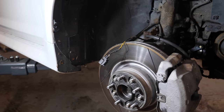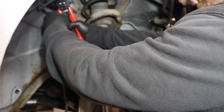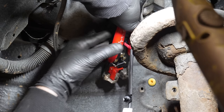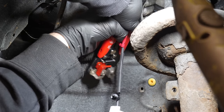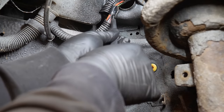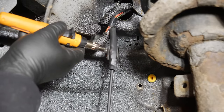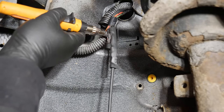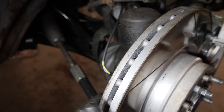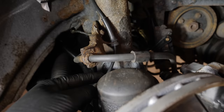This is definitely a first for me — I've never done electrics of any kind before. But this process is genuinely what they would do in a Ford main dealer: get a new cable, chop the connector off the top, connect it to the existing loom, and make it slightly longer so it stops stretching in the future, rather than replacing the whole thing with a purpose-made one. You can see why this wears through quickly — even with a little bit extra length, there's quite a lot of tension on the cable.